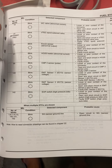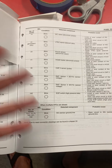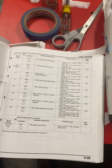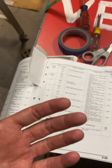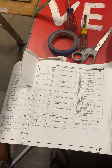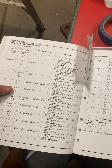It took me several months to figure this out — I didn't work on it every day, just once every week or two I'd tinker on it. Originally I thought it was Code 23, the knock sensor I mentioned in the previous video. I did all the precautionary things to resolve that: cleaning the fuel out, running clean fuel through it, checking the spark plugs. I found one spark plug that looked bad and replaced it — no effect. Then I bought a new coil and swapped things around between cylinders. Eventually it kicked a different code: Code 1, the O2 sensor.